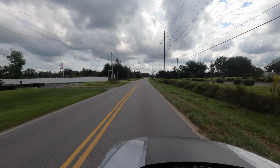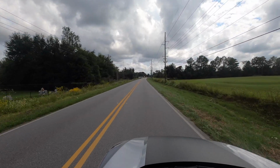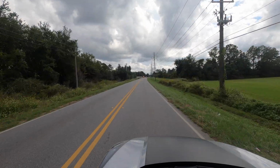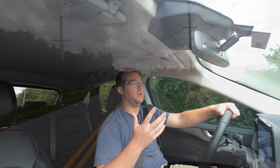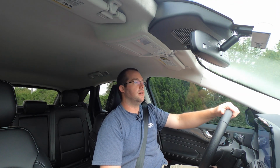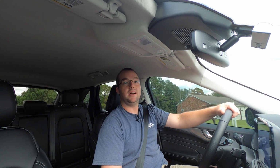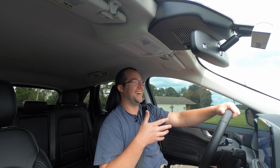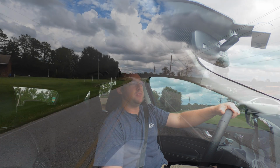So with that, that's why we took the Escape, dropped it an inch, added a set of those Dub wheels, 20 by 8.5 square with the 245/45/20 tires from Nitto. Ride quality is great. I am excited to get on it a little bit from a dig, but from a stop to really feel that all-wheel drive do its thing with these Nittos.